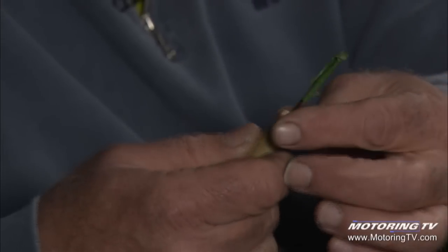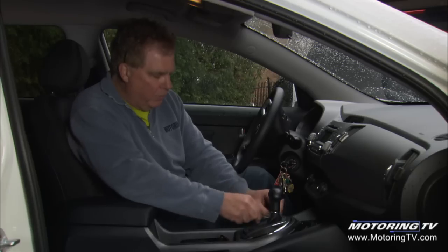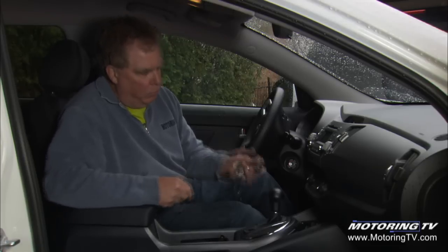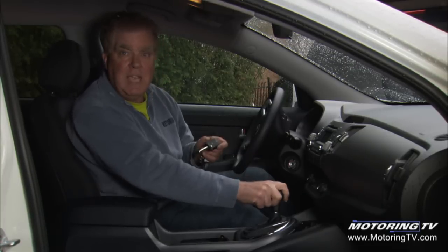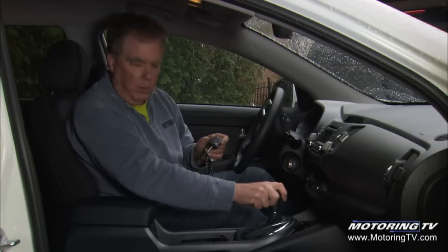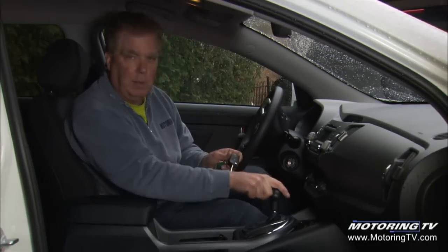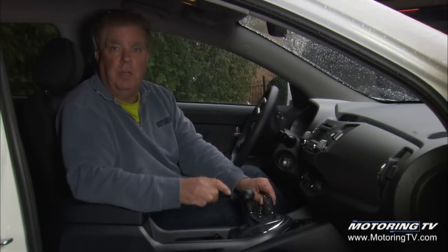Basically, what you do in this case is take a little screwdriver, tape over the nose of it so you don't scratch the console, and pop out this tiny little window that's blocking it. Then take the keys out of the ignition switch and use the ignition key to press it down in there. Now you can move the shifter out of park. Without the key in there to override the shift lock, you can see it will not move — even with my foot on the brake pedal. But as soon as you put the key in there, she goes into neutral.